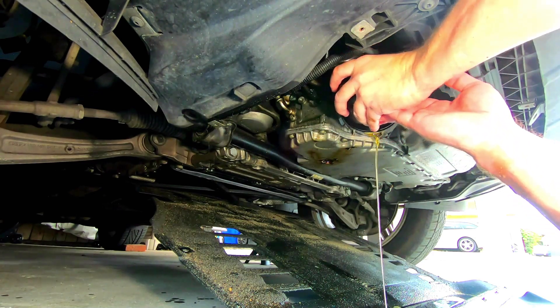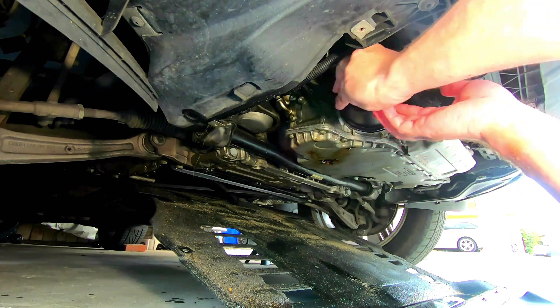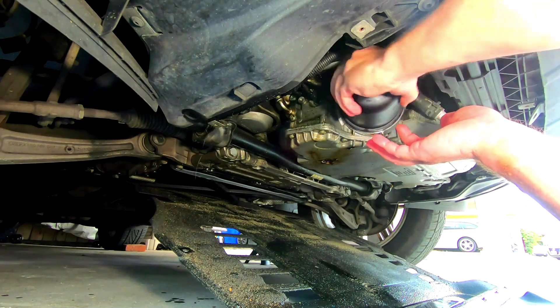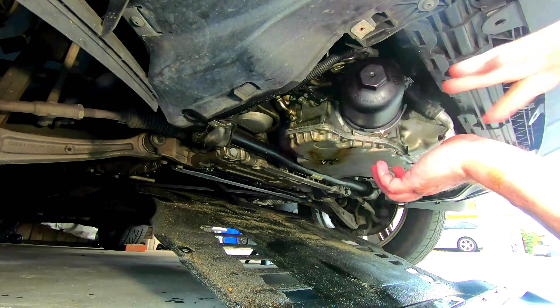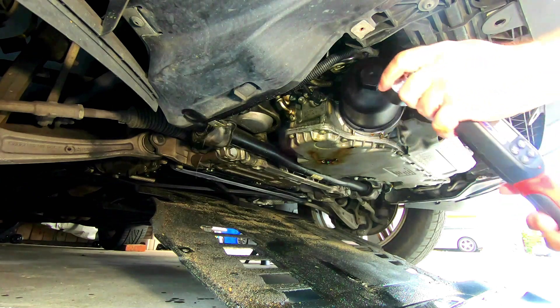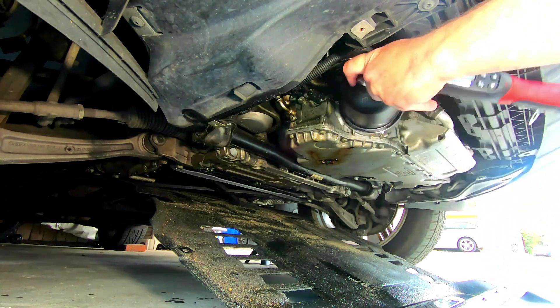You will lose a little oil when putting it back on, but make sure you're getting it in right around the hole there. You'll feel it when it goes in because you'll be able to screw it in. Then we'll just hand tighten it. The torque value for this is 18 foot-pounds — I'm going to put all of this in the description as well. This is why you really need the socket, because you can't torque it down with just a normal wrench.